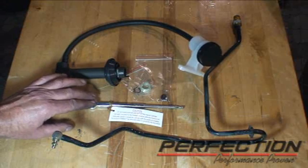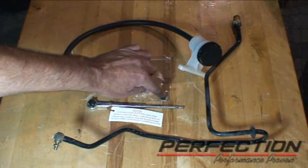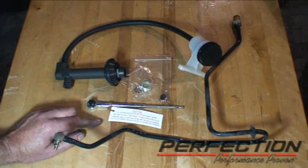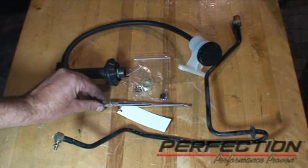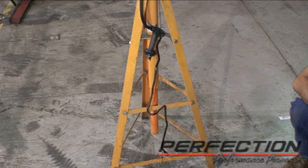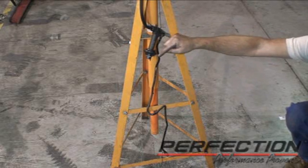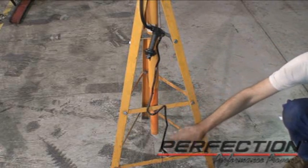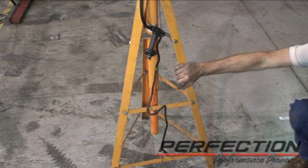This is the new master cylinder and that's the push rod. There's the old line removed from the other master cylinder. We've got a new split sleeve with a flange, new O-ring for the connector, new seal and roll pin for this connection, new reservoir tube, and a tag reminding me not to install the push rod until after installation — putting it on now just makes it a bigger package. This is how I like to set up the system to start to pre-fill and burp it: the master cylinder is angled push rod down, not push rod up. Push rod up will trap air bubbles.